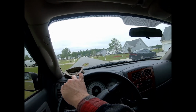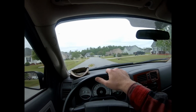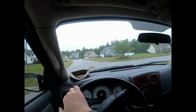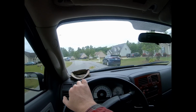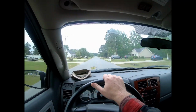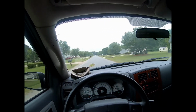And I also know that I probably damaged the pump a little bit whenever I was doing my steering rack swap, because I had a leak in the rack whenever I went out for a test drive, and my test drive was probably a little bit too long of a distance. So I think I drained the reservoir a little bit too much and ended up hurting the pump. Ever since that day, I started hearing whining from the pump, so I knew at some point it would go bad. It was just a matter of how many winters it would take. But everything sounded pretty good.